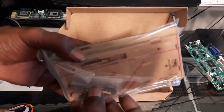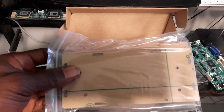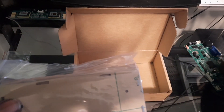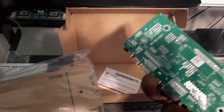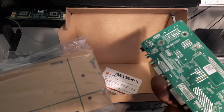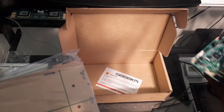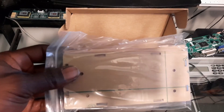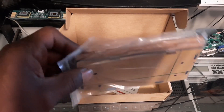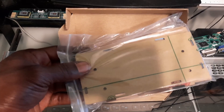This is going to be the actual plastic case for your board, so we don't have the same problem like we just had. I'm not going to be able to let the back of my board touch the screen or any kind of metal on the back of my screen, because when you do that it actually fries the whole piece. Now we're going to actually have a case, because in the back of my Arcade1Up there's not enough space to pull it far enough away from the screen.